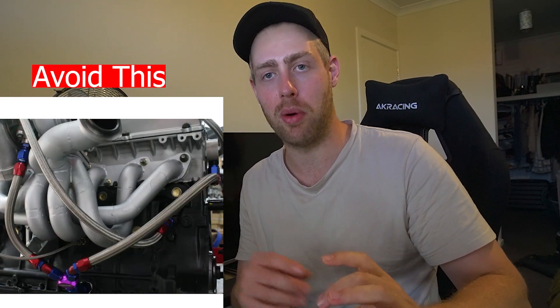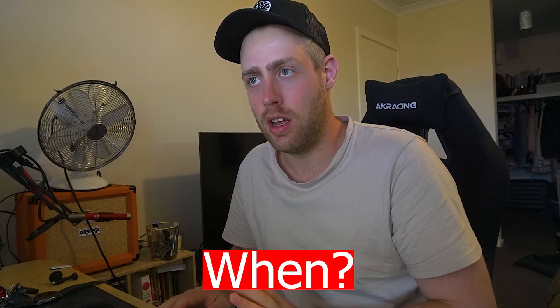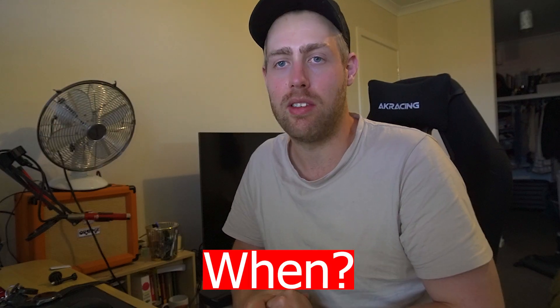In most cases you're going to have to install another fitting on the sump. In the case of the RB26, they're lucky they've got a spare fitting if you're single turbo, but I'd recommend putting it right back into the sump so you're connected to the lowest point and the highest point of the engine. CAs and some RBs actually had another breather pipe that came out the side of the engine from the block — if you've taken the intake manifold off you'll see it's under there as well.